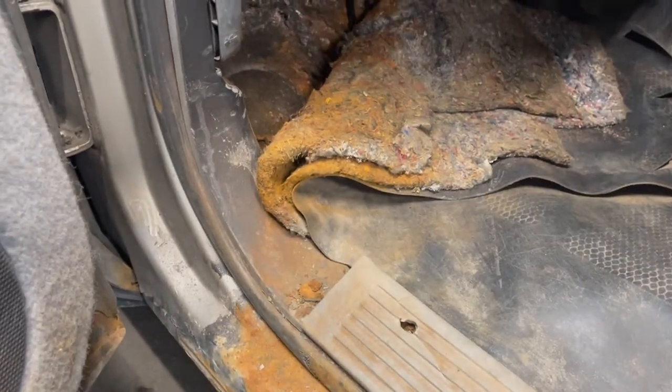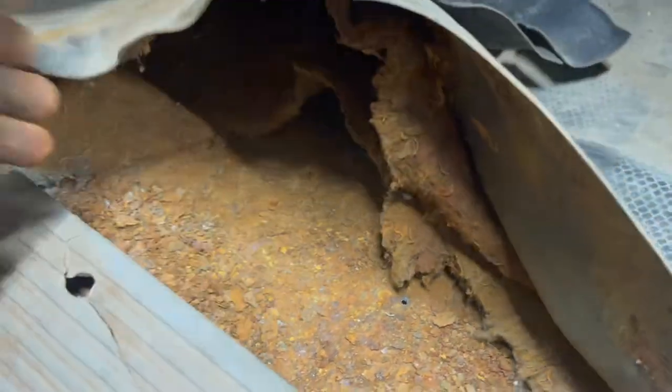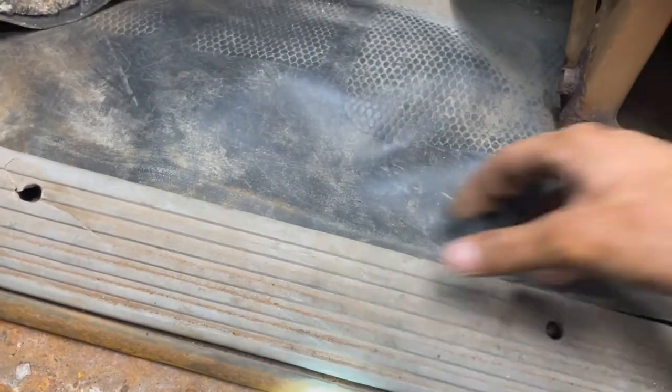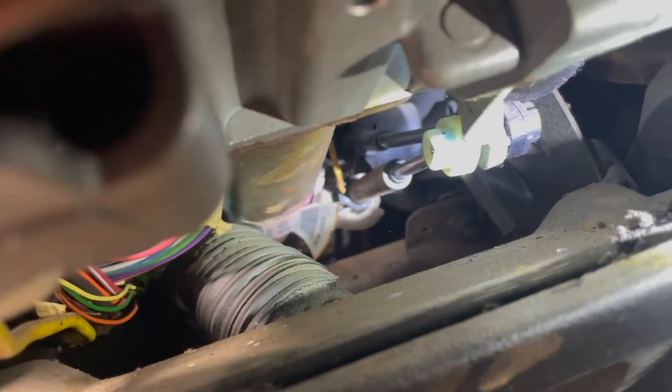Everything's pretty much back together. Because of the floor being so rusty, I wanted the cable to be routed properly and not move or kink when you put it in gear. So all I did under here was install a self-tapper with a little U-shaped clamp so the cable won't move. I'm going to hide my rusty floor for now by putting the rubber back down and just pretend it's all good until I feel like fixing it - I have a lot on my plate right now. Cable is now tied up in the factory location - just got to snip the zip tie and reinstall the bezel. You can see the new cable popped on and the safety clip back on the column.